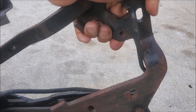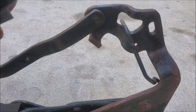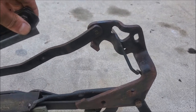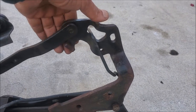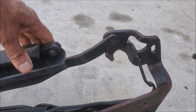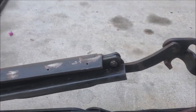As you can see, as I move this arm back slightly it moves a little bit, so I'm thinking these arms are not in parallel to the car. I'm hoping I can wiggle it a little bit so it will go down, because currently I'm forcing it down and I can see the flexing going on.